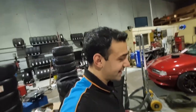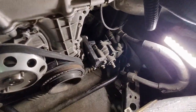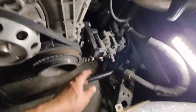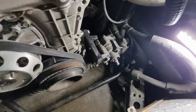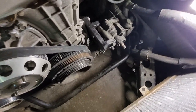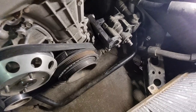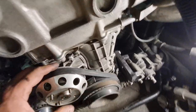That took way too bloody long, just to get the power steering belt off. So, I've got the Taarks relocation kit that drops the power steering pump down. The adjuster, even at full short, that belt is basically too tight to come off, which I knew about. So, first up, I was trying to pull this pulley off. I could not get enough movement out of it otherwise. So, eventually, she popped free and the belt came off. This one should be simple now.